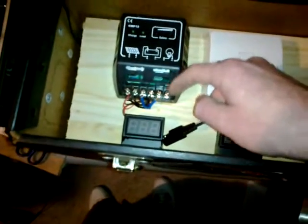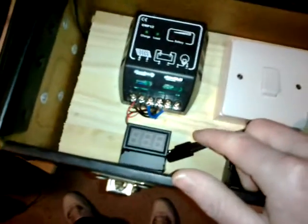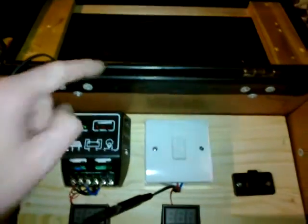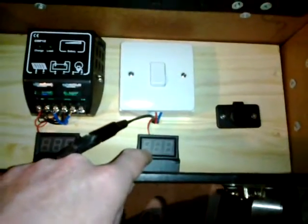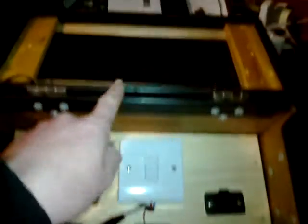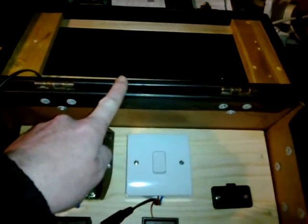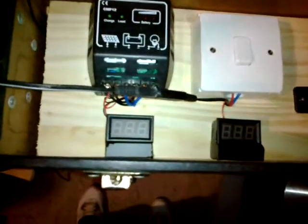Because I've lost the flap for the socket, I'm just going to put a bit of black tape over it — the handyman's secret weapon. Well, the secret weapon is gaffer tape, but gaffer tape's conductive. So we'll plug in the panel and show you that side working. The panel's plugged in — the external one. The internal panel goes straight to the battery, so it won't show the volts on here. However, if that is in sunlight you'll get a mixed reading on the total battery bank because it'll calculate what's in the bank plus any input coming in.